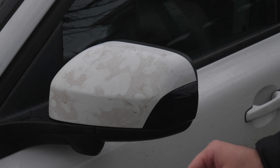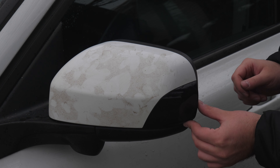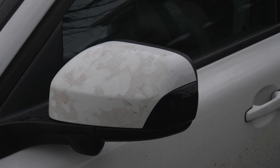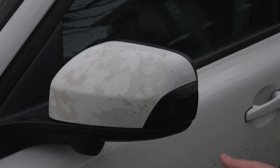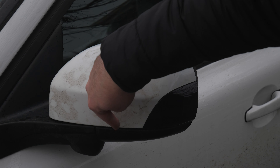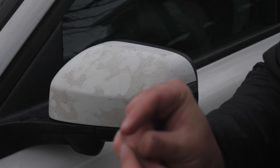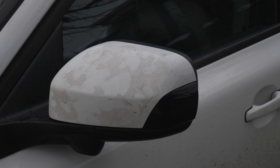I do have the assembly in. There is ever so slightly play — this is about how much it moves. It's not OEM, so the fitment is not perfect. I could probably squeeze something in there. It's not completely perfect, but again, this was a $10 or $15 part — cannot complain. It does change the look and how the light appears. When you put the mirror cap back on, super important: start by the bottom side, slide in the two bottom pins, and then the whole mirror is going to shift and there'll be about a half centimeter gap on top. Just press down on the areas for it to sit down properly, then move on to the next side.